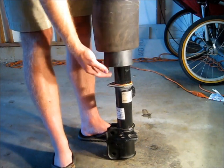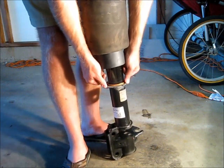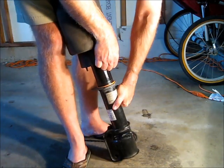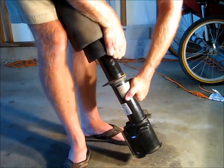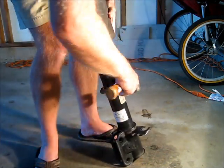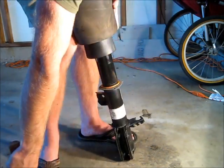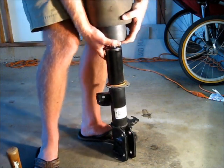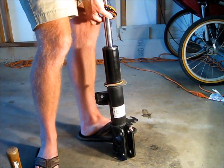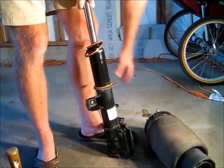We've already done all the hard work. We've begun to remove this plastic housing from the plate and we've got the bolts off the top of the air spring. Now we should just be able to continue the process of removing this air spring from the strut — just work it off. And there we go. The spring should now simply come away from the strut, and we're left with some O-rings, the strut, and the air spring.